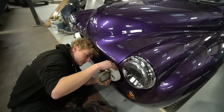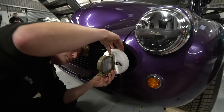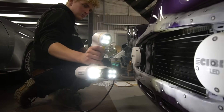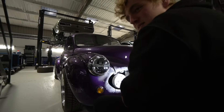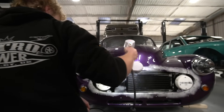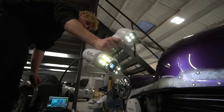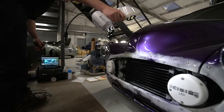On the Morris, George has been scanning the grille area. Now we've got the bonnet on and latched and finalised in its position, and the wing position is finalised, we've been scanning the grille area to make the bezel. We'd made a plastic hex mesh for the grille area quite a few weeks ago, but we want to make a metal bezel for that. The easiest way to pattern it exactly is to scan the whole area and draw it in CAD, then laser or plasma cut the surround.